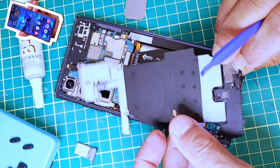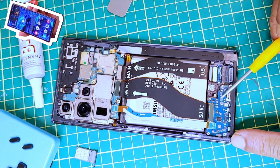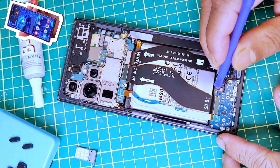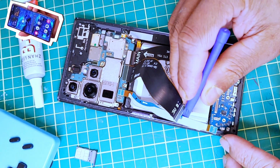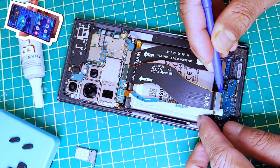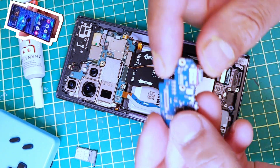This part is actually out. I think this is the wireless charging module — I can see the coil in here. Let's keep this aside. I think we have to remove three more screws to remove this chip. Pretty much all screws are removed now. We can go ahead and unplug these connectors, then pry with our plastic tool to lift this thing up carefully and remove it.